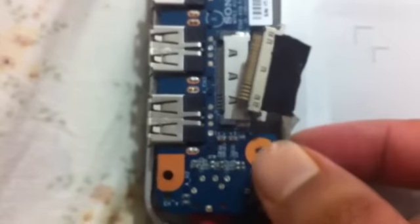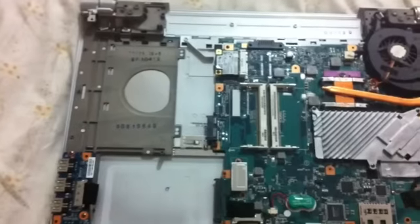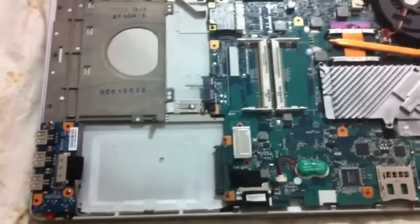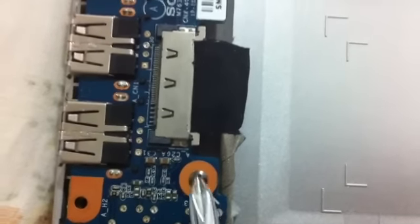I have to remove my sound card and a USB card, so there is this data cable which we have to simply pull out. There will be like two screws — one screw here and one screw here — which you have to unscrew before you take it out. This is the internal motherboard and other hardware inside the computer. This is your sound card, and it also has an indication through the arrow showing where to put the screws in.